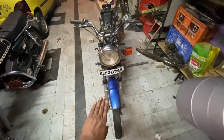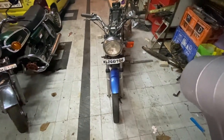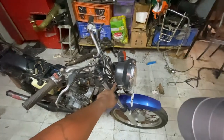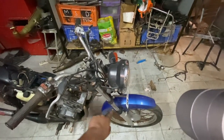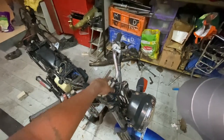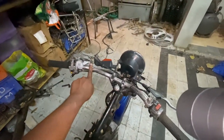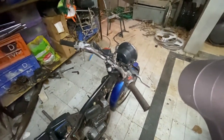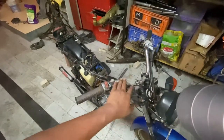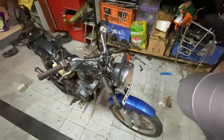This kind of number plate isn't easily available, but I've seen some selling for 300 rupees for front and back — if we find those, we'll buy new. The headlight stays will be restored. The t-stem and upper t-panel will be restored and sprayed black. The bolts will be chromed, the handle will be given for chroming, and we'll replace the brake lever, clutch lever, cables, buy four new indicators, and replace the headlight dome.